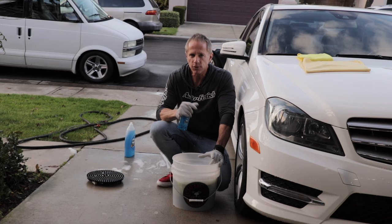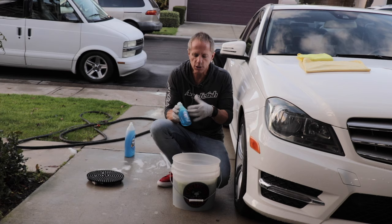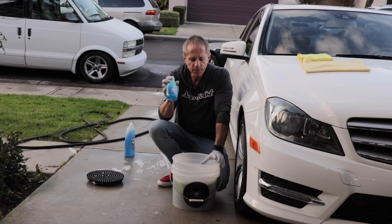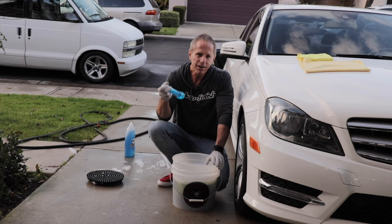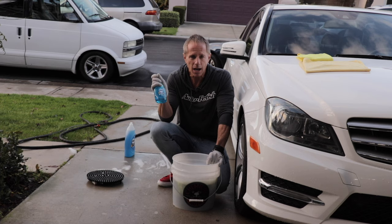But it will damage — and by damage I mean progressively remove, the more you use it — any type of protection applied to your car paint in the form of wax or car paint sealant. That's where the confusion lies. That's why people over-dramatize it and say, 'Don't use Dawn dishwashing soap on your car because it's going to damage it.' It will progressively remove more and more waxes and sealants. If you were to use this repeatedly on your hands a hundred times, it would severely dry them out. Apply that same concept to your car paint and it will continue to dry it out — meaning remove any form of protection. Therein lies the big rub, no pun intended. That would be the reason you would not want to use this if you want to retain any form of protection on your car paint.